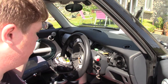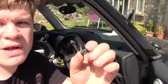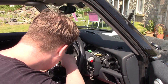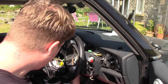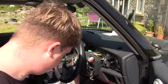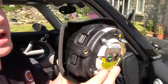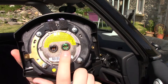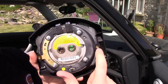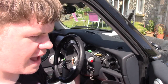Slacking those two screws off, we've got the airbag out. Now you can see the inside — the two screws are located just here and here. Once you get it out, there are these two clips in here for the airbag. You need to remove these because they're the ones we're going to be clipping onto the new airbag when we put the new steering wheel in. That little cap — just keep that for safekeeping. You can see that is the airbag we've removed. There are the two little connectors you'll need to disconnect, and the two gold screws are what you need to remove to get the airbag out.